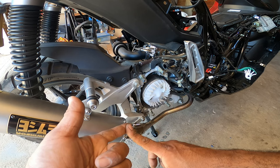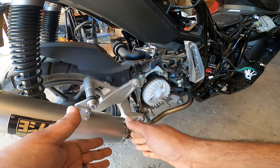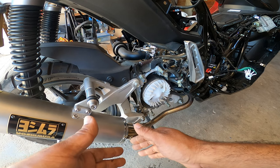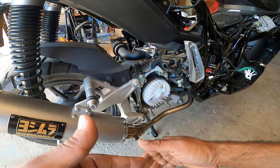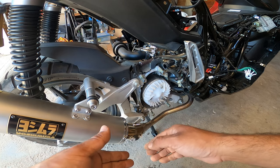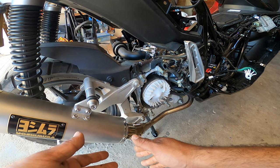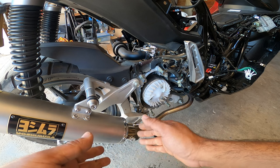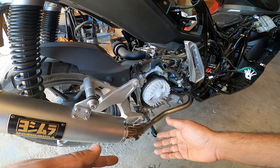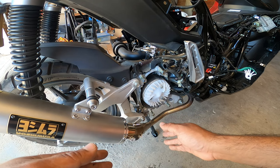So next step now is to remove the intake manifold and the throttle body and kind of move them out of the way. That gives us access to the chain tensioner. And then from there, we're gonna remove the valve cover and then the water pump, and then give us access to the cam to yank the cam out. And we should be pretty much moving forward even more so. I've never done this job before, so I am using pretty much a DIY as reference online, and a Scooter Swap Shop DIY as well for reference. I'm just going more thoroughly than everybody else is doing online.